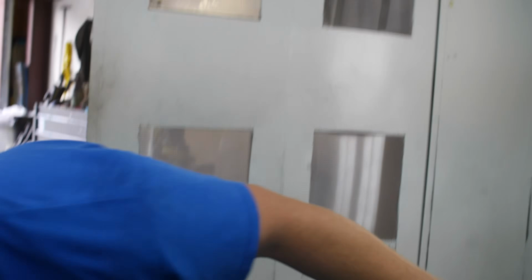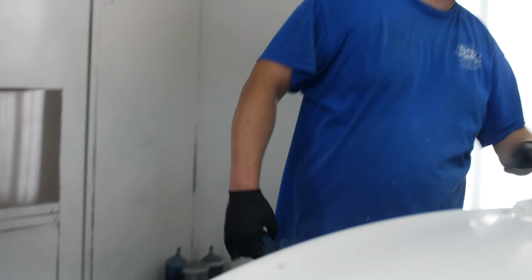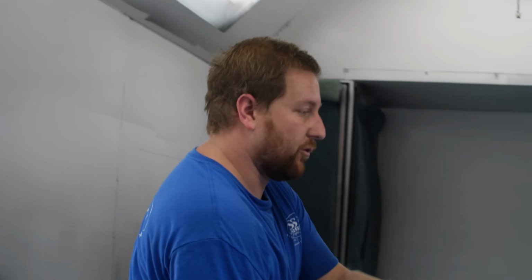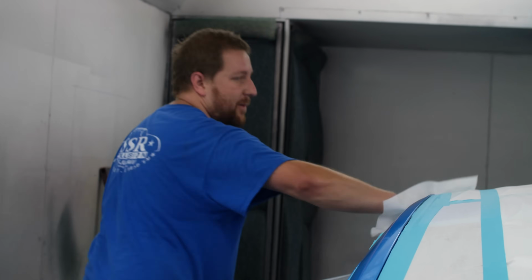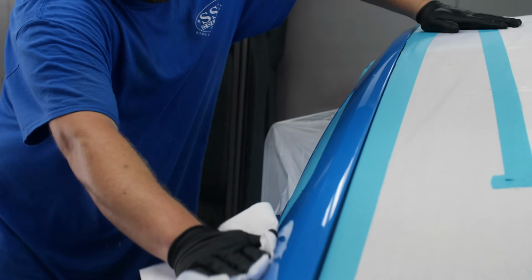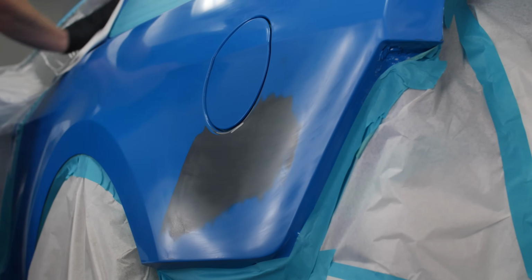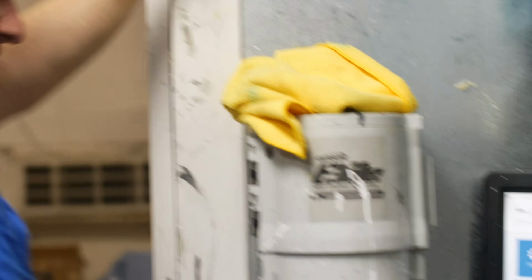We already wiped it down before we started prepping the car for paint with a chemical called SX394. It's basically an organic based cleaner. It removes tree sap, organic road grime, bird droppings, stuff like that. What I'm wiping it down with now is a wax and grease remover. That gets anything synthetic: road grime, tar, fingerprints, oils off your hands, really anything that could possibly contaminate the paint. So this is a TouchMix XI system. It's for PPG. The computer goes to a server that's outside of our paint mixing room.